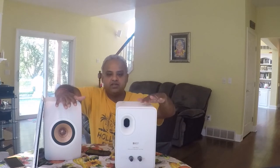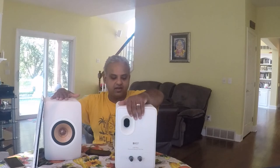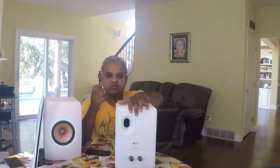There are some visible cosmetic changes as well, including this beautiful matte finish. This piece is called Mineral White. It's also available in Carbon Black, Titanium Grey, and the most elusive and super gorgeous Royal Blue. The speaker is rear ported like its predecessor — the port location and flare is offset to delay the onset of turbulence, and the flexible port walls are set to prevent resonances from colouring the mid-range.